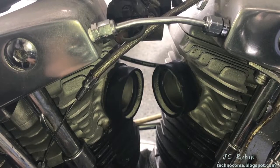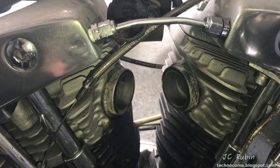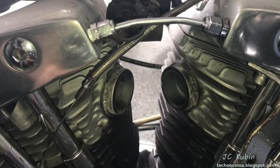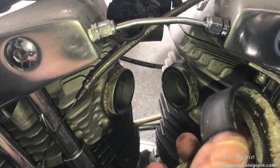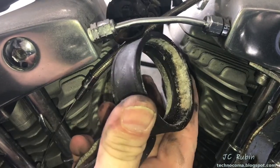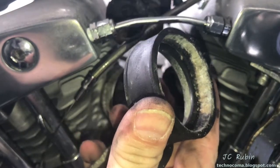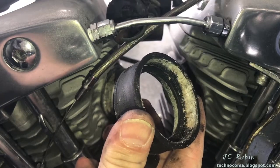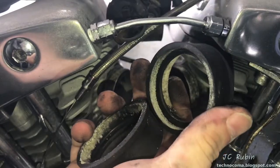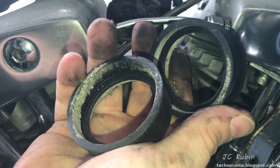This is not alarming but it's worth noting, and it happened on both sides. As I removed these rubber rings you can see the oxidization around the heads right here on the mating surface, and it tells you that moisture was getting in to cause that. This could be easily cleaned up; the new rings could go on. I'd like to see something besides rubber, or maybe treat this with something so that moisture can't get in, because it oxidizes and causes air to get in, which does cause an issue. These should be inspected now and again to make sure you're not having problems with these seals.